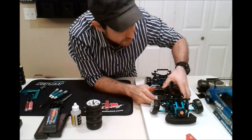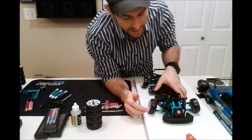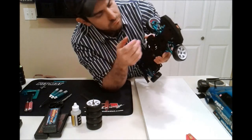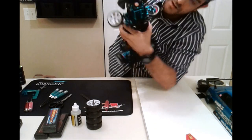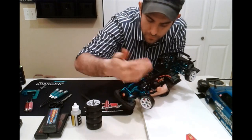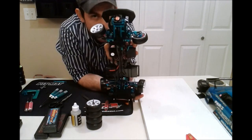One pro tip: to get wider offset in the front — meaning wider offset means more grip, more control, more driftiness — I added a 2mm spacer inside the little area there. On top of that, I added a 3mm suspension mount inside of there. That affects both sides, bringing the wheel out. The reason I did that is so that when I go full lock, I have more space between my rim and tire and the shock, so it's not touching and I can get parallel lock.